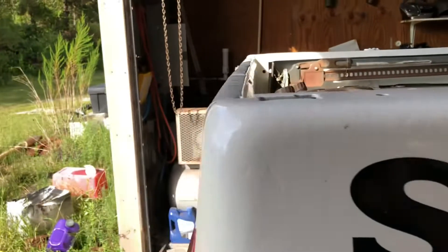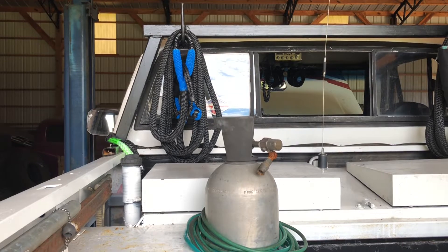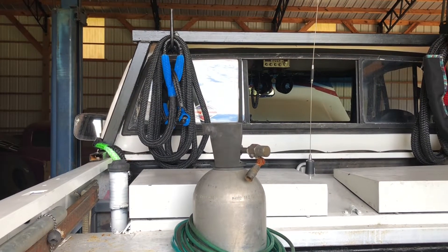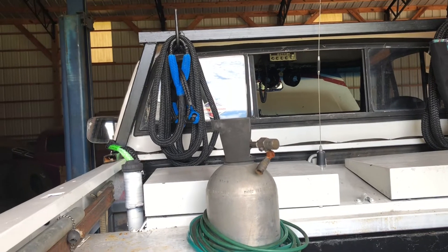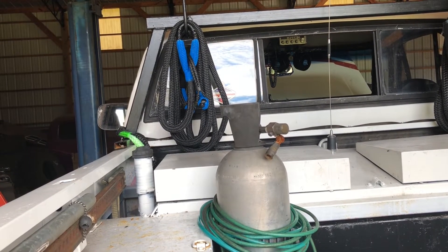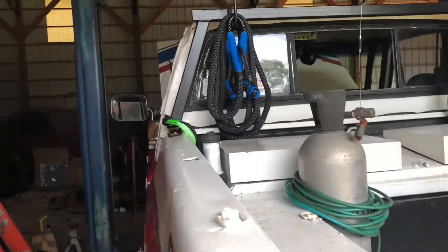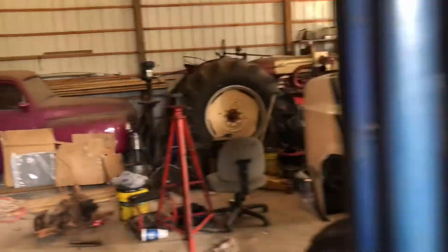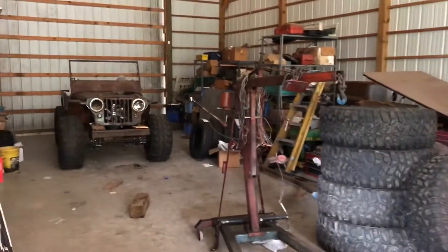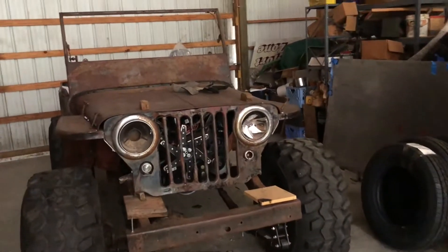This is a lot of my opinion from my experiences — take it for what it's worth. That's why you will never see me on an off-road rig with an electric fan. I will always have a mechanical fan unless there's absolutely no way around it. Even the little flat-fender Jeep I'm currently building, I'm running a mechanical fan on it — not a clutch fan, it's going to be a flex fan. Everybody talks about having more room with an electric fan, but I have measured and measured and on the little Jeep there is more fan room with a flex fan than any electric fan I could find.